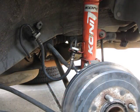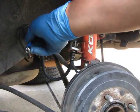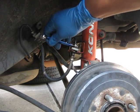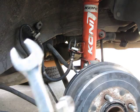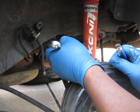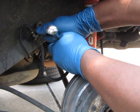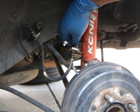The first thing you want to do is use your little wrench and loosen the nuts. This part goes over the brake line and then you just turn it clockwise. That one's loose — same here, over the line. Now see how that one is moving a little bit? It's not quite in there correctly, so that's when you would use your 17mm to hold it so it doesn't turn. Let me get that on there to hold it. There we go — and that is step one.